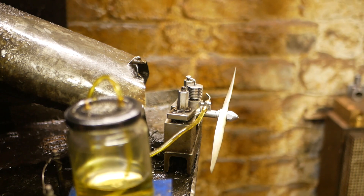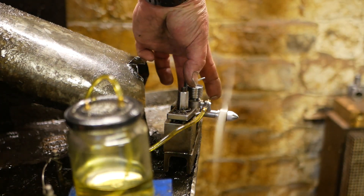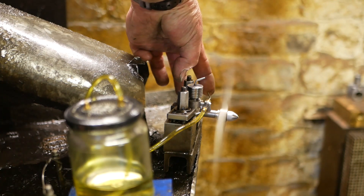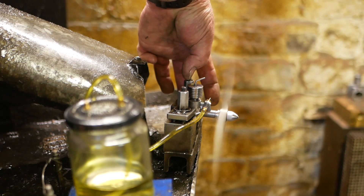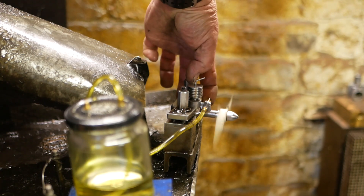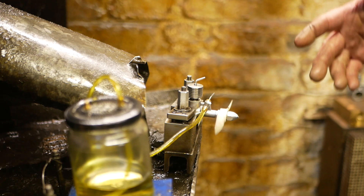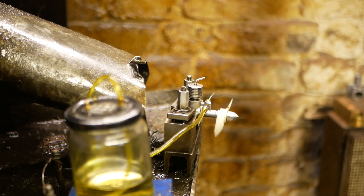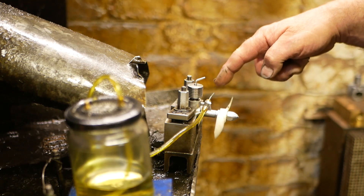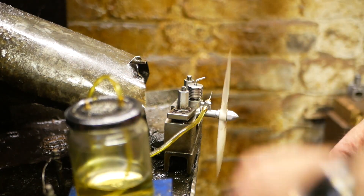Now we'll deal with the needle. Turn it back to the starting position and draw the fuel in once. I opened the needle to start off with and the engine got richer and slowed down — if the engine was stopped in that position it would be more difficult to start. I then screwed the needle valve in; the revs rose higher and higher. When they went too far a misfire occurred and the engine cut out altogether. I've now returned the needle to its original position. We're now at the starting position — one choke flick, or let's try two choke flicks.